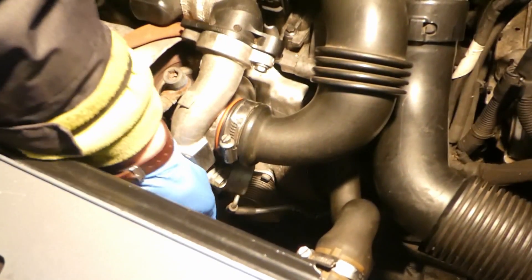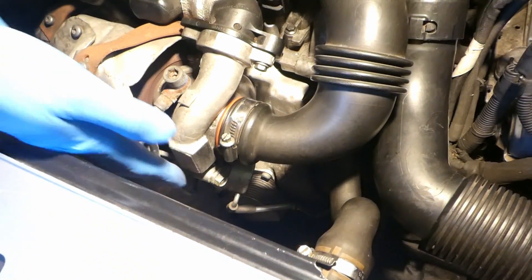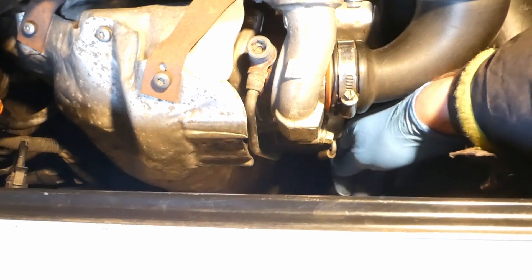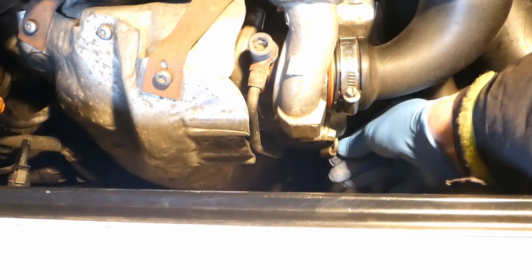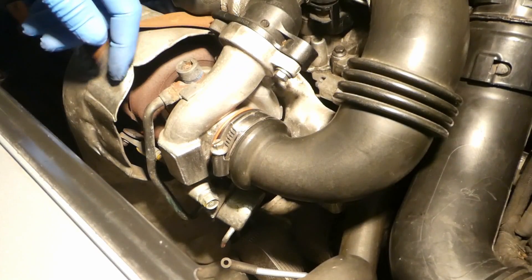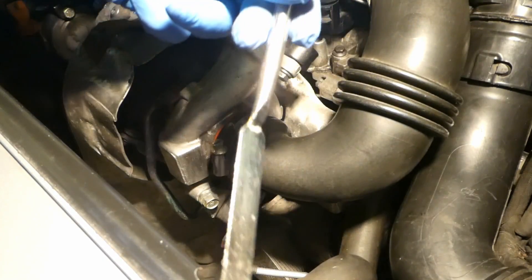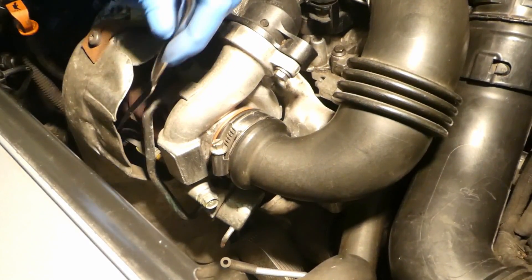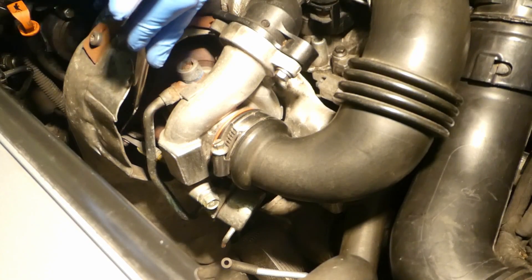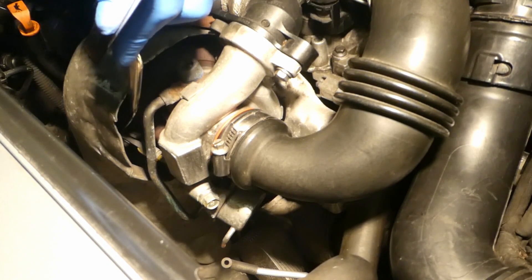You can push it slightly and then kind of undo it. Push it — it's better done on a warm engine but everything's really warm. So you pull the vacuum hose there. This is the same actuator — the same thing inside the car. The shield is here so I cannot quite easily push this rod. I have a metal tool just to leverage on the shield and see if this really operates. You can see it's actually moving down there.